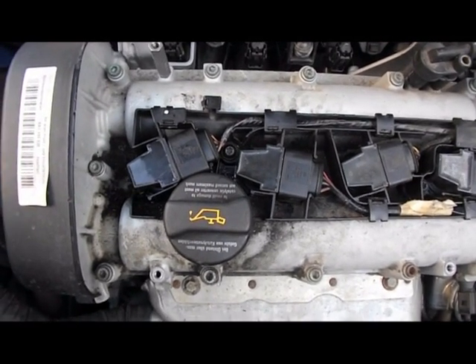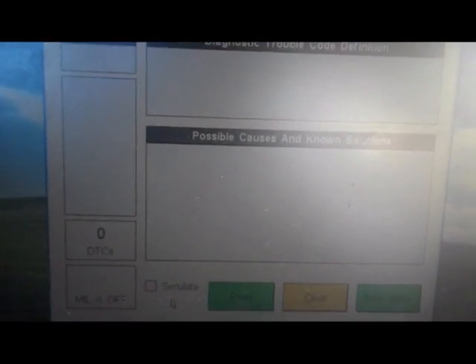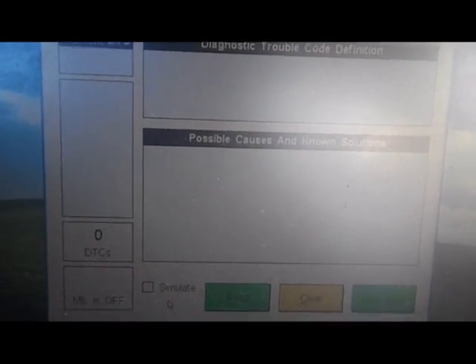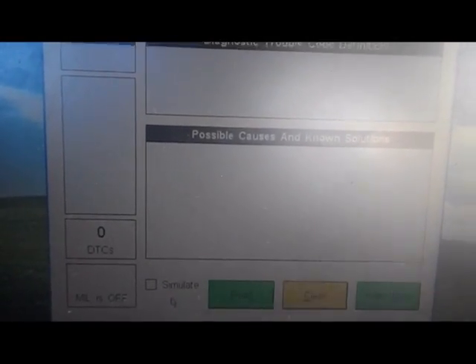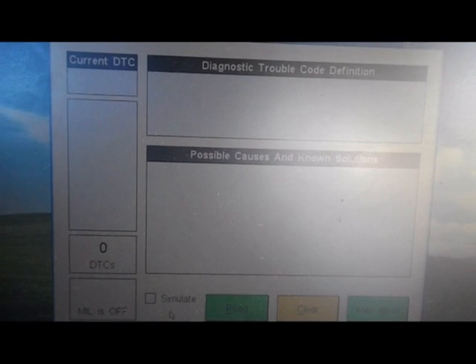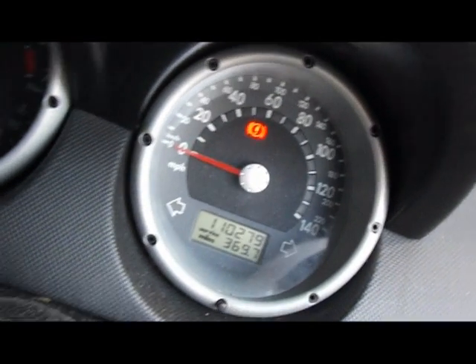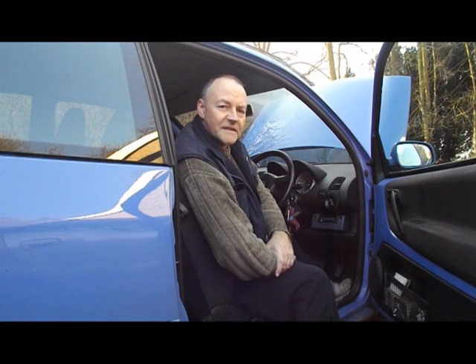All I've got to do now is clear the OBD2 problem off the dash and put the cover back on. I've put in the new coil pack and I've just cleared all the fault codes that came up — because when you're working on it with all the removing and refitting, it comes up with other faults. But it's all cleared, there's nothing showing now. On the dash there's nothing showing apart from the handbrake light. So that's another problem sorted. That's TC here saying thank you for watching, and take it easy. Bye.